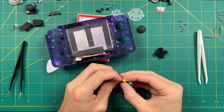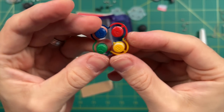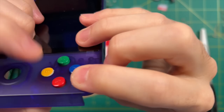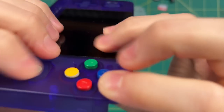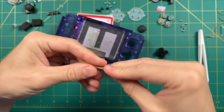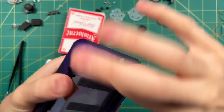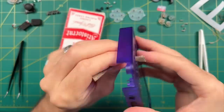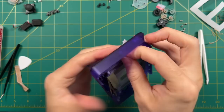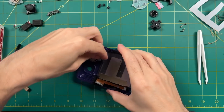Because the yellow B is so bad, I'm going to use sandpaper along the edges of the button itself — just a tiny little piece of sandpaper, going around in a circle to scrape off the edges. I spent altogether maybe three or four minutes and pulled off most of the paint on each side. The button feels a little bit better but it's not fixed, so I think we're going to have to take some drastic measures and sandpaper the inside of the shells. I'm going to roll up the sandpaper into a little tube, go into each of the buttonholes, and roll it around to scrape along the edges.